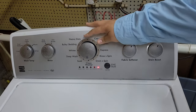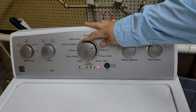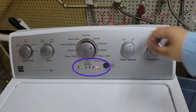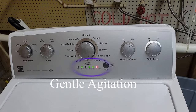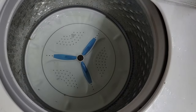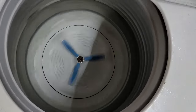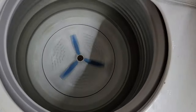I'm selecting the manual test mode, then engaging the lid lock, which is required to have the machine run agitation or spin cycle on test. Generally the commands I'm doing here are the same among all Whirlpool-built washers, but you can always find the service manual in the washer to confirm that. With the gentle mode selected, we're going to run it for quite some time by pressing the start button. We found that running the test cycle only runs the agitation for about a minute, so unlike a regular wash mode, you may have to babysit it and run it multiple times.